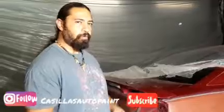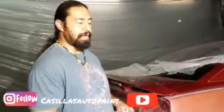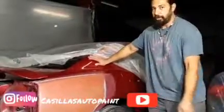It's normal. So we use the DuPont primer. Remember, four to a half to mix it, and then the spray can Transtar 2-in-1 red oxide, because the car is red. So now what we're going to be doing to finish it off: this was 600 wet sand, right, guys? Because we're going to keep its existing same color, we're going to do everything else with 1,000 wet. You'll be seeing me do that right now. That's the next step.